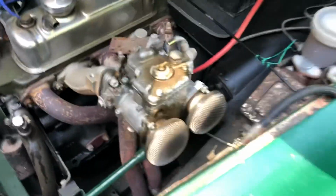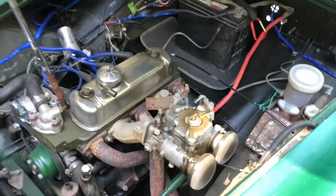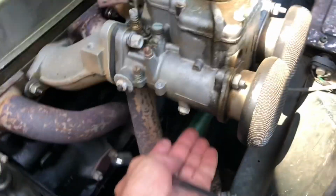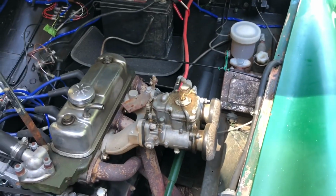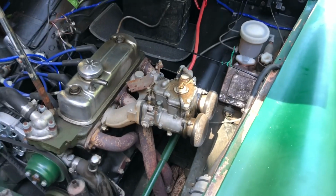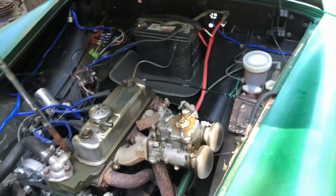This is an old Italian 40 that works okay, except it's developed a small leak. I suspect from the bottom on the underside is the accelerator pump goodies, and I notice when you come to a stop you hear a little bit of a drop of fuel landing on the header when you shut it off, so that tells me it's probably leaking while you're driving, although it probably blows away by then. But anyway, been meaning to do this for a while.